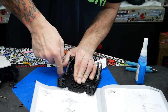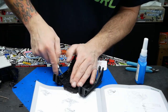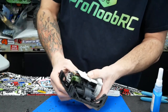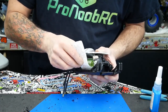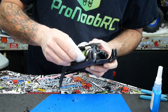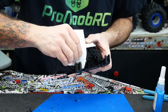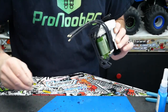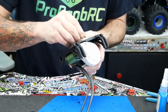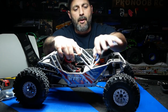So you want to make sure nothing's touching the motor. Once you're satisfied, that clicks in nice — I can visually see we're no longer touching in there. This guy slides back underneath nicely all the way through, all the way back to this corner. We're good. We can lock that down — a couple of these screws go into the motor plate. Make sure you use Loctite on the screws that go up into the motor plate; the rest just go into the plastic. Power plant covered.